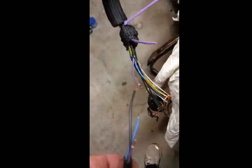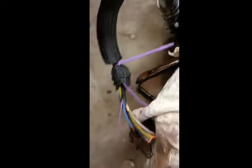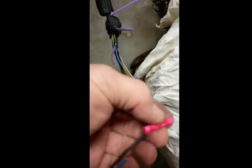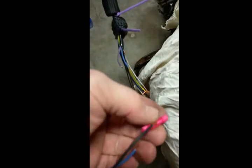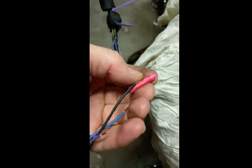Quick tips: cover your tank so the stuff doesn't bump against your paint job. Cut the wires staggered, and when you're cutting them, cut a quarter inch off on one side or the other. That way when you put your butt splice together you allow for that extra quarter inch or so that's going to be in there.